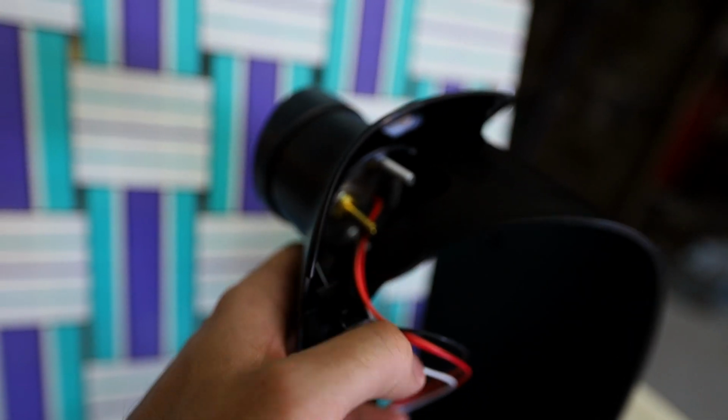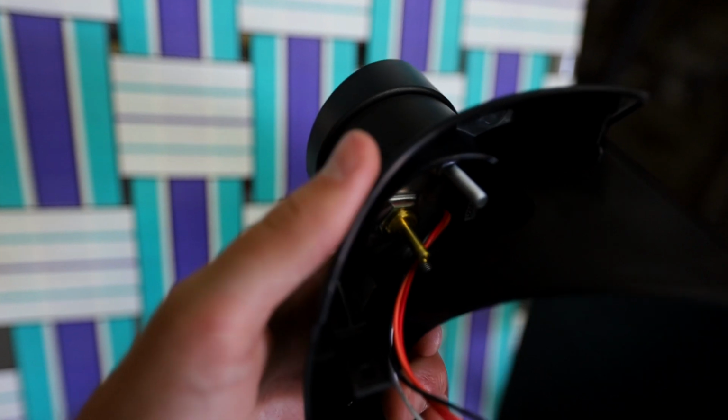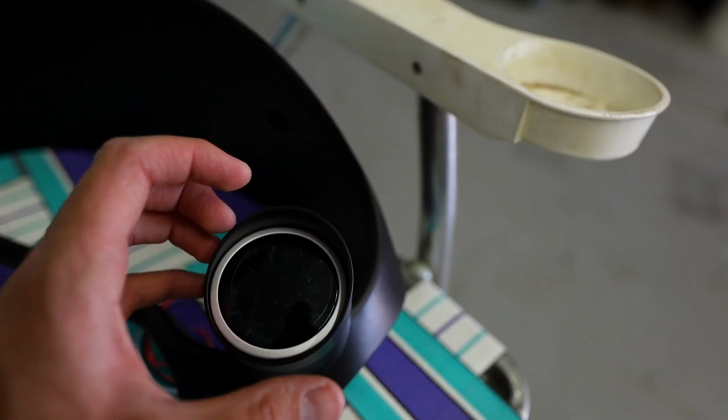And because I have the 2 bolt studs on this gauge, in order to get it to fit, you either have to space it out like this or you have to have it clocked so that the gauge is super crooked in the pod. So I'm thinking at some point I'm probably just going to cut those studs off, but for now this is going to work, and because it's mounted with the rubber bands, it's really easy to remove. You can just pop the whole thing out, so cutting the studs off at a later day won't be a big hassle.